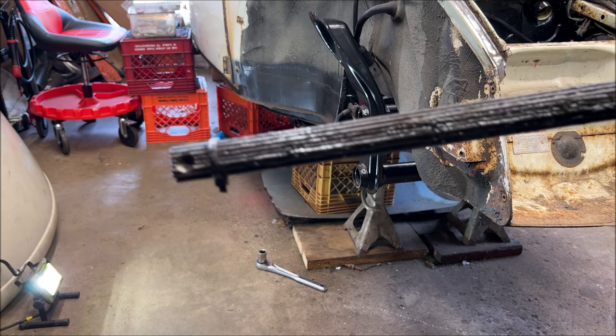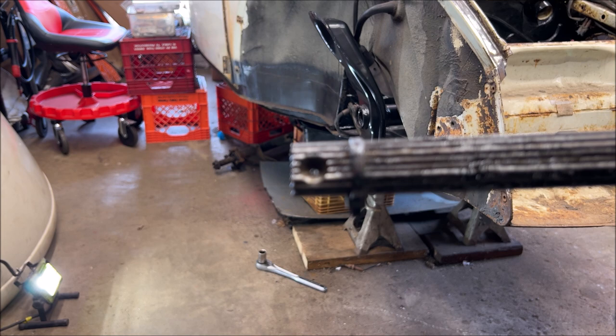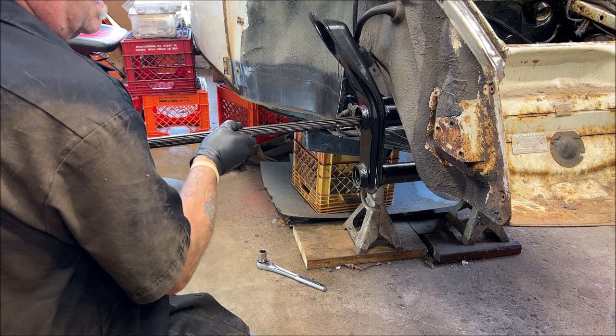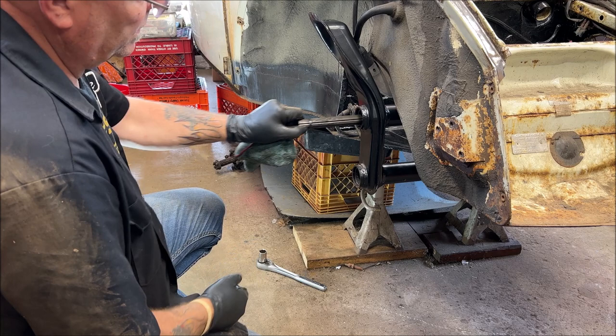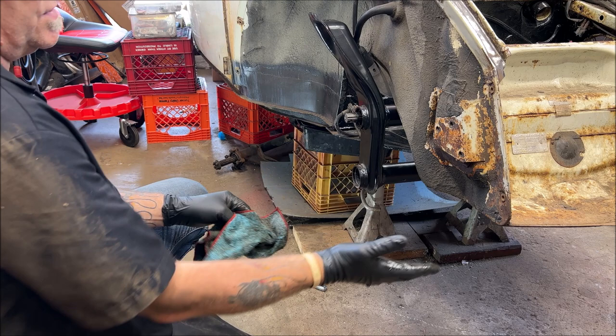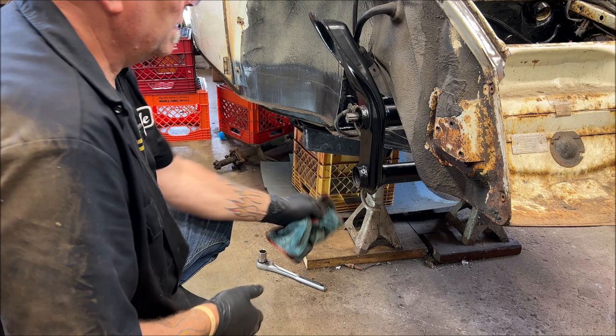We have our torsion leaves. I'm going to do the top first. Now, as you can see, the dimple, that's where your control arm will go on. When you put it in the top and I'm on the passenger side, you want it facing you. You'll see what I mean. So, here we go. Now, this dimple, I'm on the passenger side, will be facing you. I hope that makes sense to you. It should, right? I guess so. I want this nice and clean.